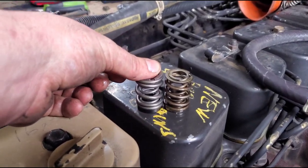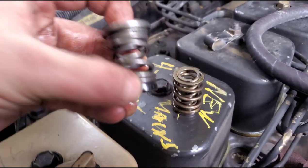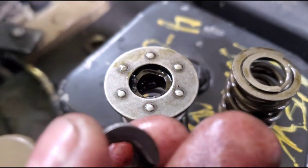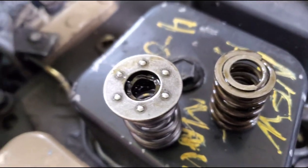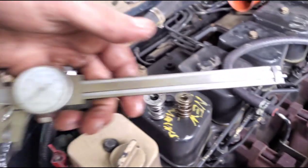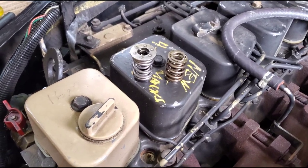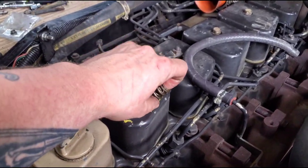It's a little bit beefier — lets it rev a little higher. It has this seat on top, and you can see there's another spring that goes around the outside, plus this little wavy lock thing in there. It's like a flathead screwdriver slot with a stud that sticks up, and it's wavy too. I dropped a caliper down in there to see how far it's set on the stud — it's 40 thousandths. It's supposed to be between 40 and 60 thousandths, so that's good.